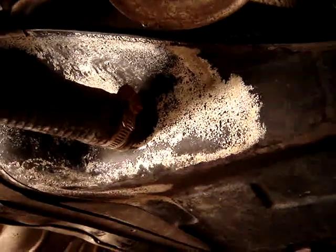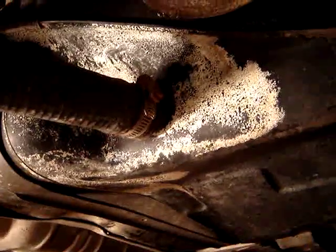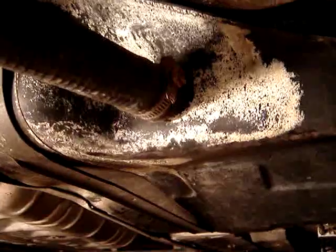This has to be a vacuum-type problem with a bad vent. The solution is to replace the vent with a revised vent that BMW came up with some years ago, and also to replace the charcoal canister, because it gets saturated when the vent becomes bad and gas gets into the charcoal filter.